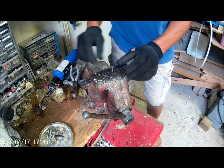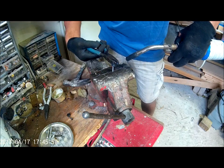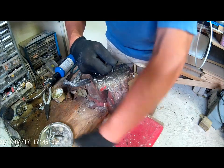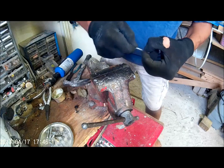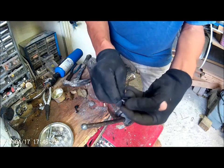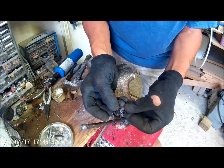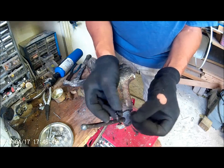It's not going to get a whole lot of heat. I'm going to soak this in water to really set it. This is not bad. I took a nail and flattened the end of it on the anvil so that it would hold itself in this notch. Here's the repair — this is the old one. They're both kind of roughed up because I welded that other piece on, but as you can see they're reasonable. I'm sure I won't have the same spring action, but it gives me a chance to get some more life out of it. Order one of these springs in case it takes a month to arrive.